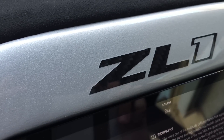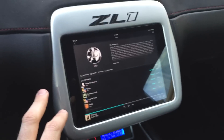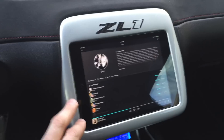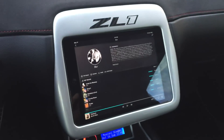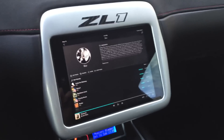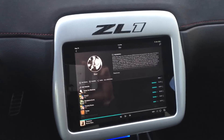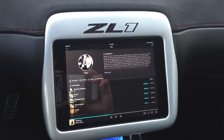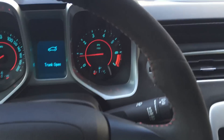I did carbon fiber on the kit itself — it's kind of hard to see in this lighting. I made the whole kit, finished it off, and wrapped it in 20-ounce carbon fiber. Then I put a ZL1 decal up top, painted the whole piece silver, pulled off the decal, and cleared it until it was smooth to the touch. So your carbon is built into the piece — visually and aesthetically it looks like a factory-made piece. It matches the carbon fiber I did on the rest of the dash, the door panels, and the steering wheel. Carbon fiber wraps all the way across — all handmade, handlaid.